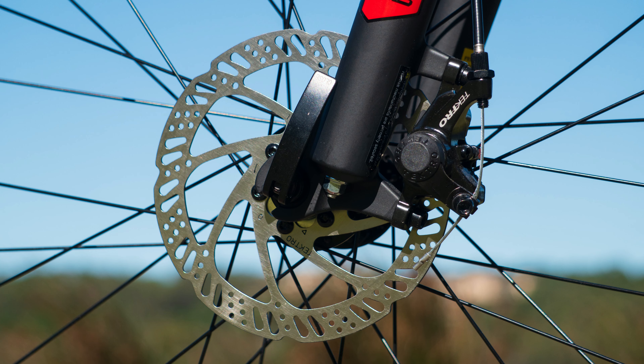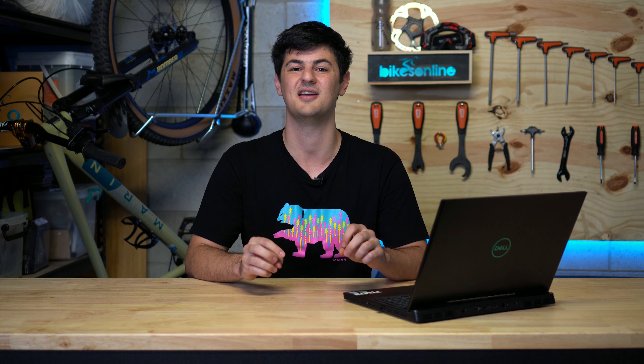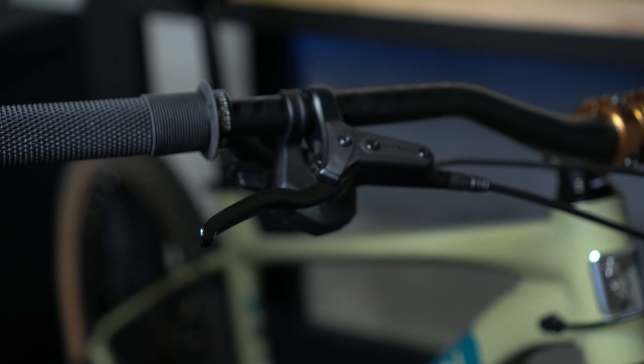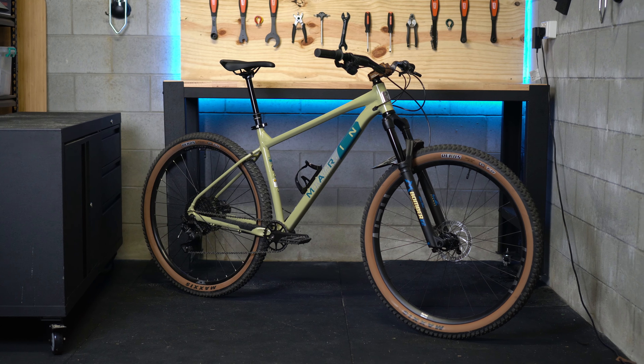So there's my top five — but what about hydraulic disc brakes? Most entry-level mountain bikes these days come with either cable-actuated disc brakes or hydraulic disc brakes. For me the other upgrades would probably come first, but hydraulic brakes would be a quick upgrade after everything else, especially if the bike comes with cable-actuated disc brakes. With cable-actuated brakes, if they're adjusted properly you can actually get half-decent performance from them — but if your bike comes with rim brakes, upgrading to disc brakes would be my first move. In short, hydraulic disc brakes give you more power and better modulation, really allowing you to start attacking the descents. Especially once your bike is as capable as it will be after all these upgrades, you really need brakes that can stop you.